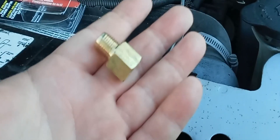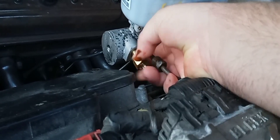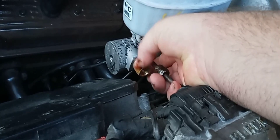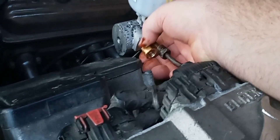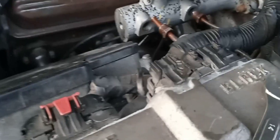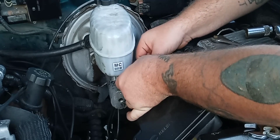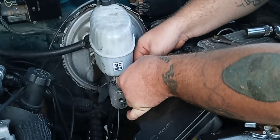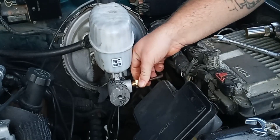I'm pretty sure I got the right one this time. This is BLF-26C — the one Google referred to was BLF-22C. Let's see if this thing will thread in here. There's so much rust on this. Okay, that threads in. Now we just need to see if it'll thread up to the stock brake line. As you guys can see, BLF-26C threads into both the brake line and the master cylinder.